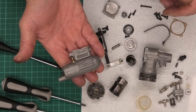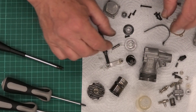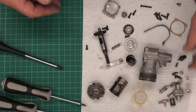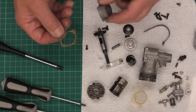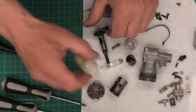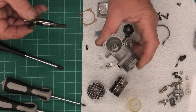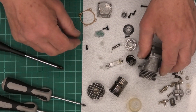Let's move the camera around and get this engine built back up. I've given everything a bit of a coat of oil — this is air tool oil, I use it for after-running and building up engines like this. I've also made a gasket for the back plate. First thing, we'll put a little drop more oil on the crank and slot that into the crankcase.